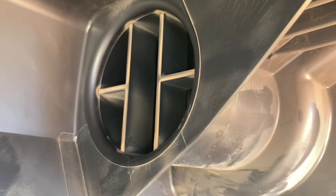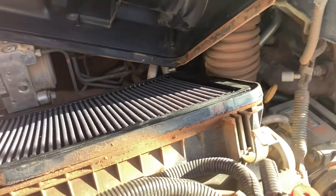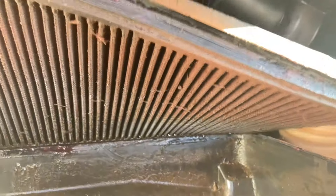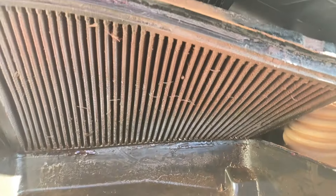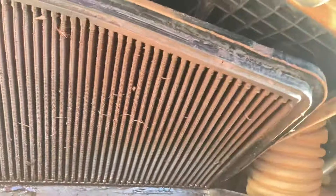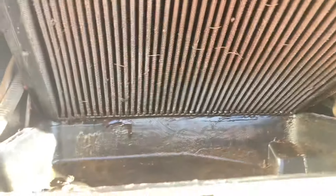The oil doesn't go there where the air doesn't flow - that kind of makes sense. Where the air flows down here, let's have a look at the MAF sensor. A little bit dusty but not too bad - that really doesn't look much different to the one with the genuine filter. But the dust here is more spread out; with the genuine filter it was thicker in one spot. This one shows fine dust getting through but it's spread. There's plenty of oil in the bottom of the box on this one - it's done the Simpson Desert and the WA trip.